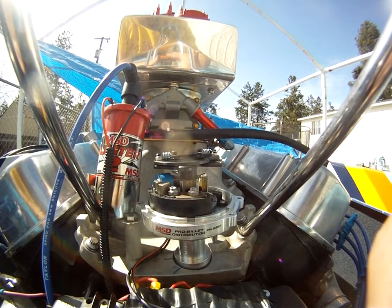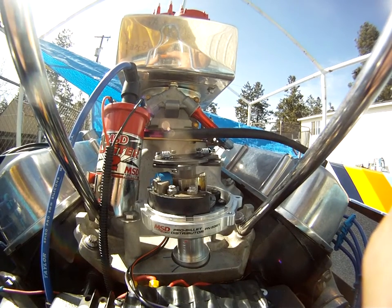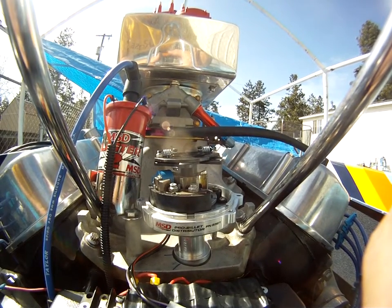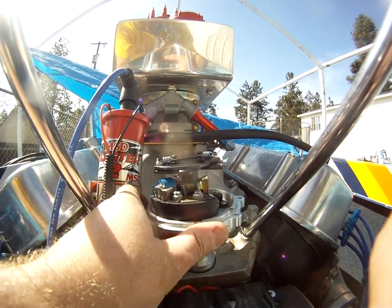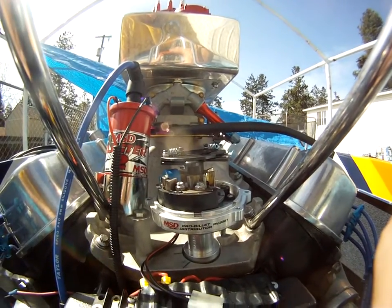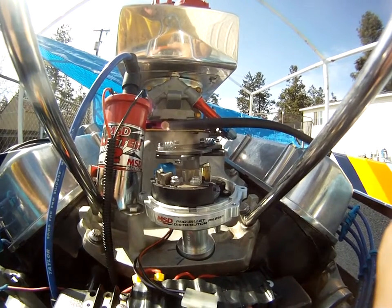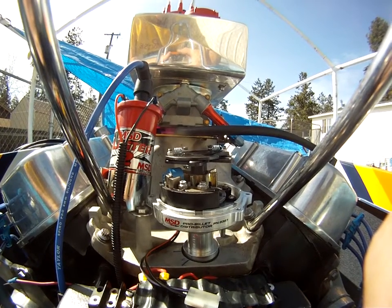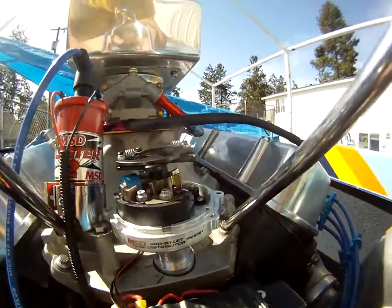My initial timing is going to be about 16 degrees. What I recommend is that you don't worry about setting your timing at 16 degrees — you worry about getting full timing at 2500 to 2800 RPM. Bring your engine all the way up to 2800 RPM and check your total timing — it should be around 36 degrees. Turn the distributor until you get it set at 36, then lock it down. Let it idle and see what your initial timing is — it should be around 16. Check it because the bushing could be a degree or two off. I go by total timing, not initial timing. The total timing you want is 36 degrees — some say 34 to 36, but usually it's 36. That's what makes the guys run at the track.